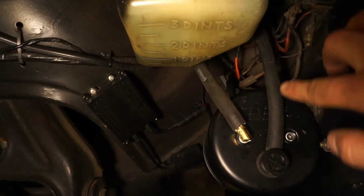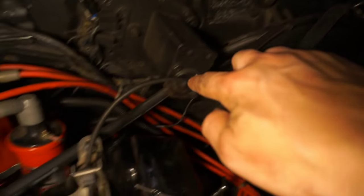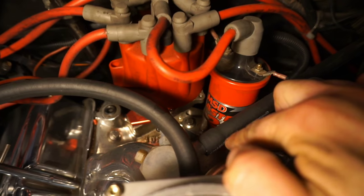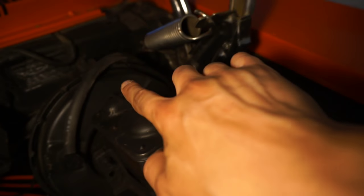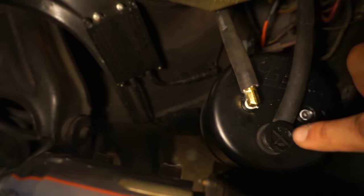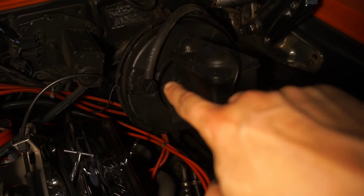Line from the intake, through the fender, around the back of the booster, to the vacuum port on the intake manifold. One line from the booster goes through the fender to the brass fitting. Each line gets its own little plastic check valve — one there, one there — and that's it. Pretty simple install.